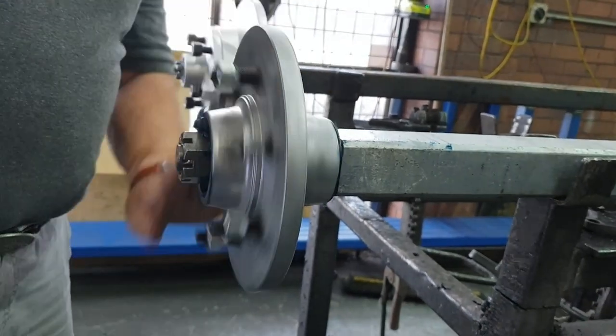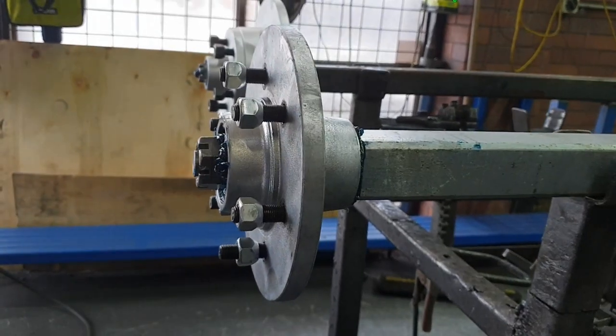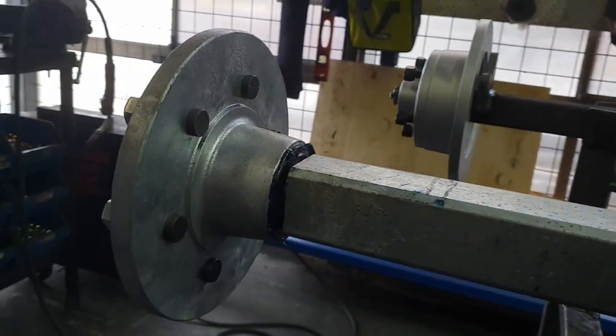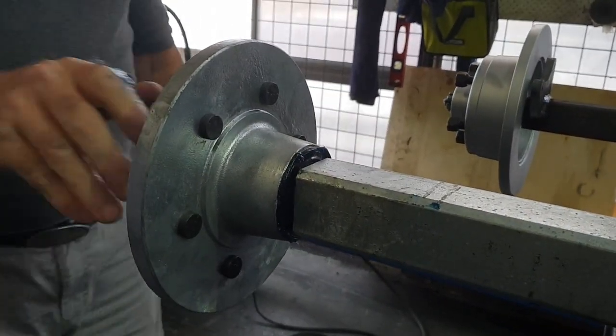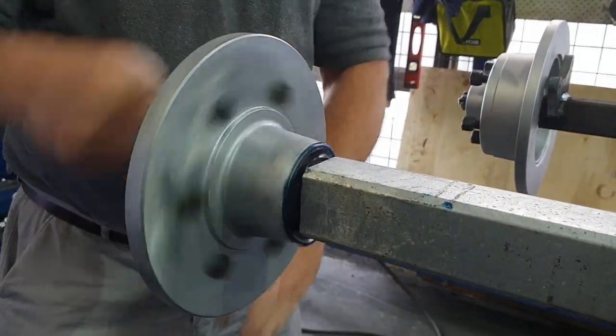There's a good chance it's going to overcook the bearings and melt the grease. Just have a look at the back there — don't forget to clean up the excess grease and don't overfill your cavity.